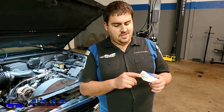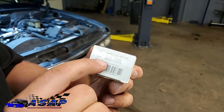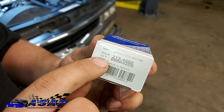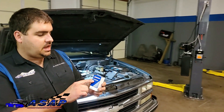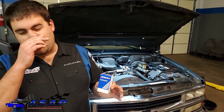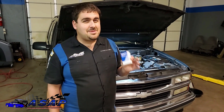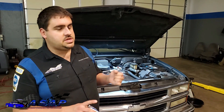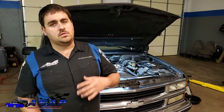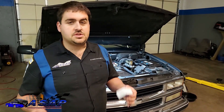In my particular application, this is the part number we used. The ACD is your ACDelco number — 2134668 — and the actual GM OEM number for this is 88864359. I like going with ACDelco stuff because they're an OEM supplier for GM and have been for years. I like to go with their professional grade stuff. When you're online on something like Amazon, be careful — if it's their cheaper line, the internals are cheaper quality. It's only a couple of dollars difference on these TPS sensors, but a cheap part will give you so much headache. Spend the extra couple bucks and get the professional level one. A good Delphi or Denso is also normally really good to go with — those cheap knockoffs are just asking for trouble.